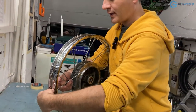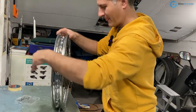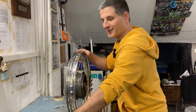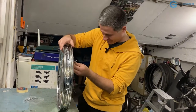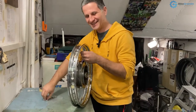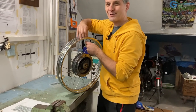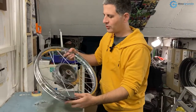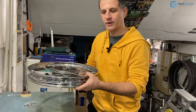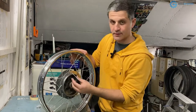I am competing for the most boring video against the dripping faucet, so please like, share and subscribe. One more thing: you can use some wooden planks to hold the rim above the ground and something to support the hub so you can work more easily. With heavier wheels it's often a good idea to do that. Here, this is for a relatively small low-powered motorcycle, so I can easily do it almost like a bicycle wheel.